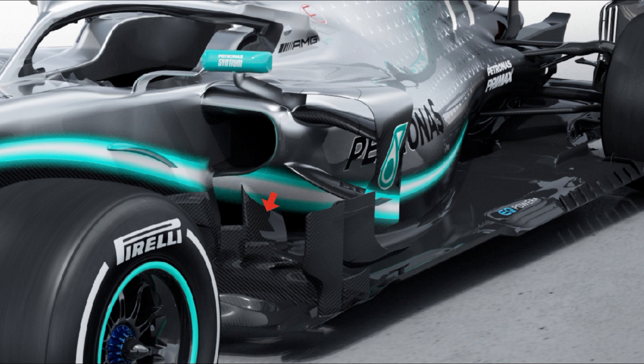Buried away beneath the side pod is another flow-diverting aid. These flank wings prevent airflow from otherwise overshooting the side pod undercut, improving flow downstream and limiting its ingress to the now critical longitudinal floor slots. These slots, a feature of the cars under the 2017 regulations, have grown in popularity, as they help create a number of vortices that can be rolled up to create a sort of air skirt on the floor's edge, increasing the floor and diffuser's yield.